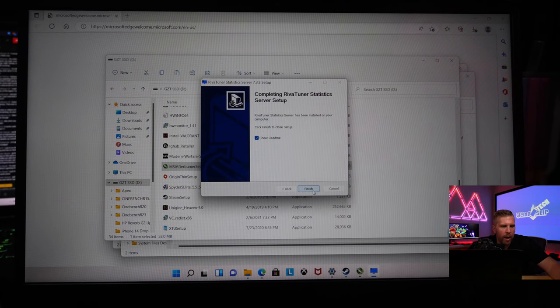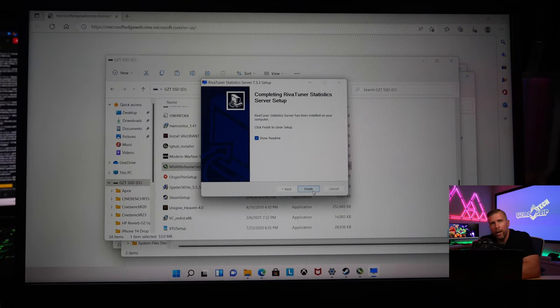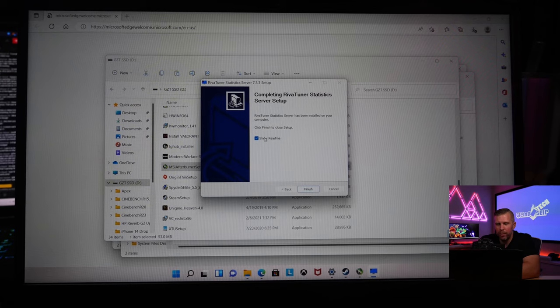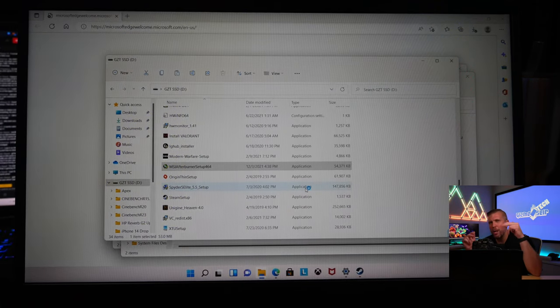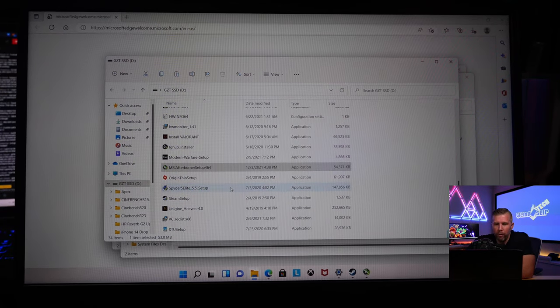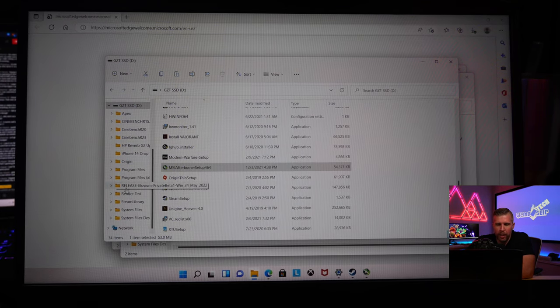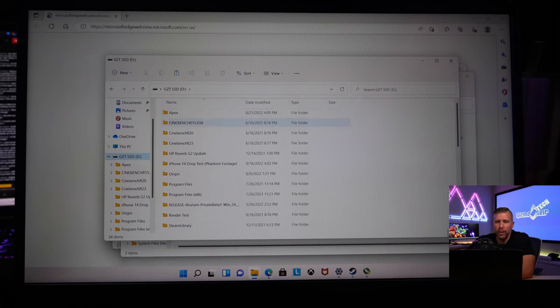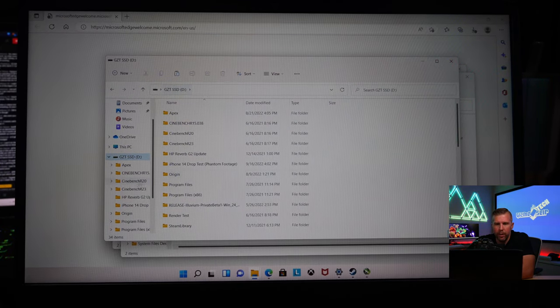Interesting. Is 8 gig of RAM even enough, even for a budget? I think 8 gigs is enough if you're on an extreme budget and you just want to, like, watch Netflix or browse the web or something. That's all you want to do. And it's enough in the sense that you'll be able to do those things. But you would almost always be able to do those things smoother or more efficiently if you had at least 12 gigs of RAM. Probably 16 is ideal, but 12 is like the minimum in my mind. But usually you don't get 2 6 gig sticks. Usually you get 2 8 gig sticks, so usually jump straight to 16. But 12 gig theoretically should have been enough.